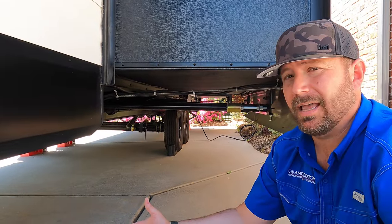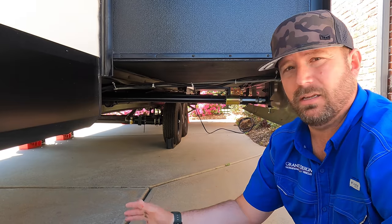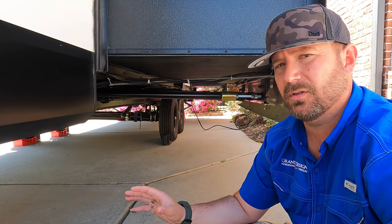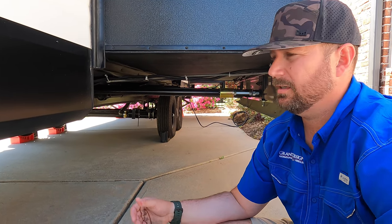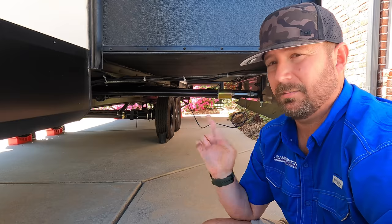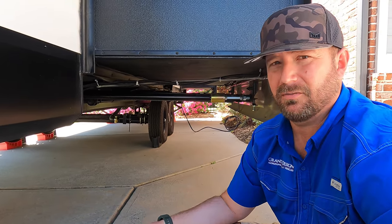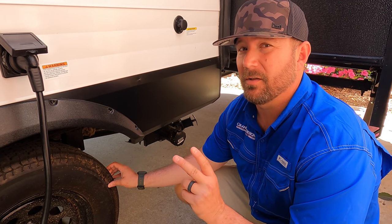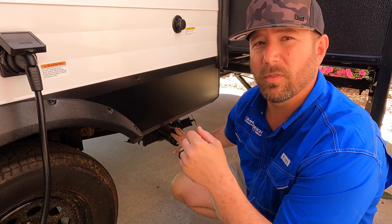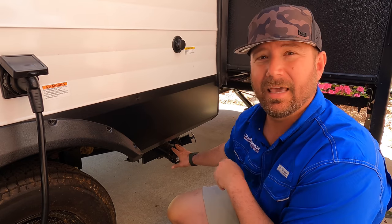You may be asking why we're under the slides — I want to show you the slide mechanisms they're using in the Transcend line: rack and pinion through-frame slides. That's a big deal. They're a little heavier than other slide mechanisms, but a lot of entry-level units will use cable-type slides — those cables stretch, get off track, et cetera. I love that they use these rack and pinion slides; they're heavy-duty and going to have fewer issues. One con to throw in right here: two dump valves. You've got a hookup near the galley and one back here for the bathroom and shower — I wish it only had one exit.